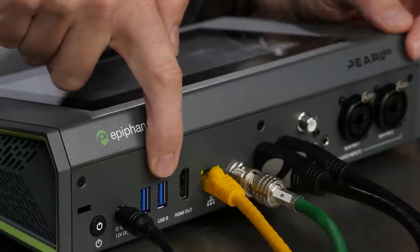Now I had said in the first unboxing that you could plug a USB webcam in, but I was wrong — Epiphan told me you can't do that on the Pearl Mini. It is for connecting external hard drives or a USB modem. You can tether if you have an LTE stick, or apparently even connect your phone — so if you have a tethering plan, you can USB to your iPhone and connect to the internet that way. You don't need a hardline ethernet connection to stream.